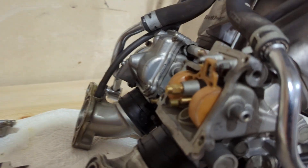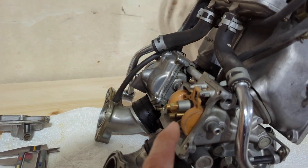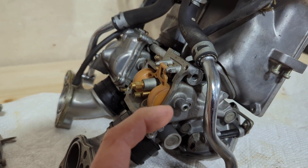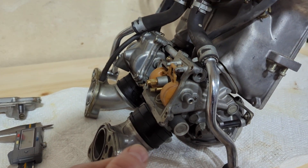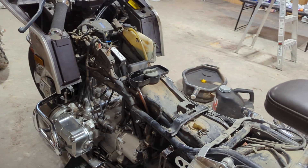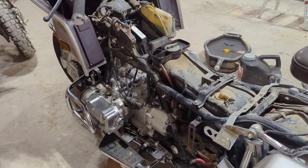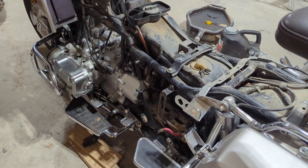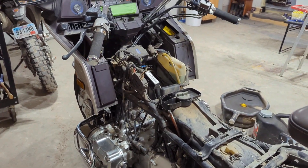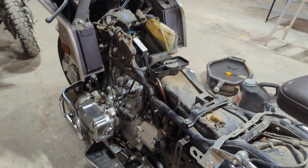Mine were way off — this one was the worst. When I put the caliper on there, there was almost a quarter inch, so it was bad. I ended up changing the oil because the bike sat for a few months. I went to start it, it wouldn't start, I kept trying, burned out the starter which I have to replace. Come to find out it was hydro lock.